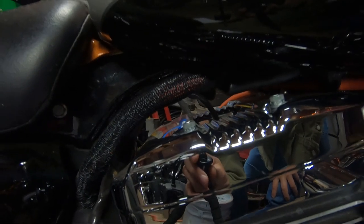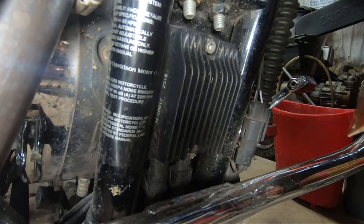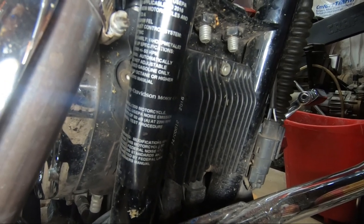Also new for 2014 and up models, Harley-Davidson introduced the CAN bus system — a more simplified wiring system with a body controller, rather than a plethora of relays, fuses, and switches to operate the electrical system. Harley-Davidson says with less wiring and fewer components, it also gave the bike a much cleaner look — the only visible wiring you can really see is about the extent of the wiring harness on these bikes. To go along with the new CAN bus system, Harley-Davidson also updated the voltage regulator with larger fins for improved cooling and better electrical reliability.